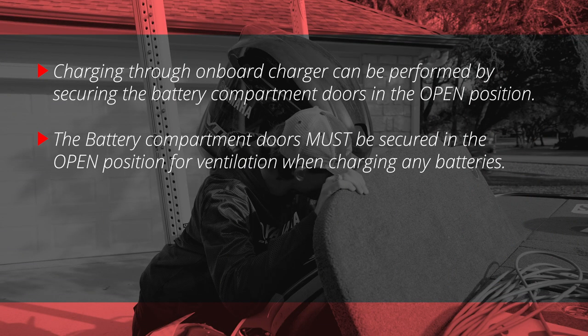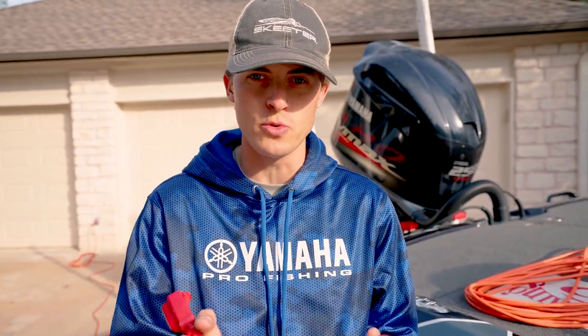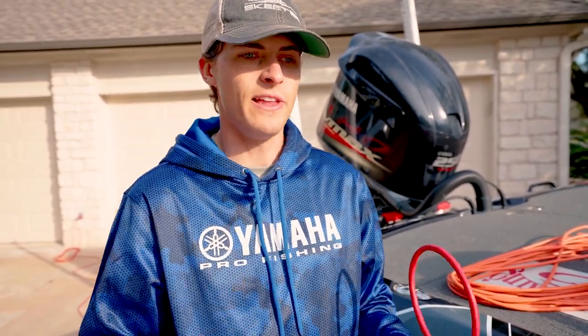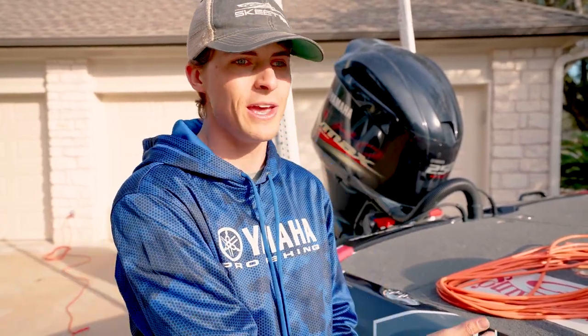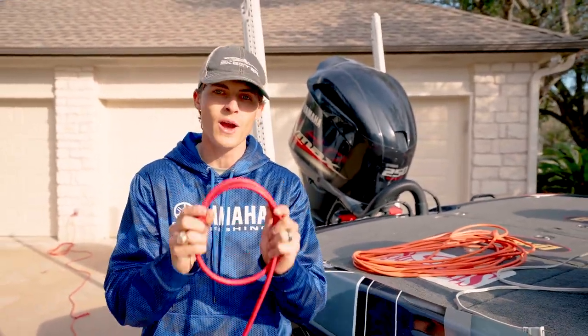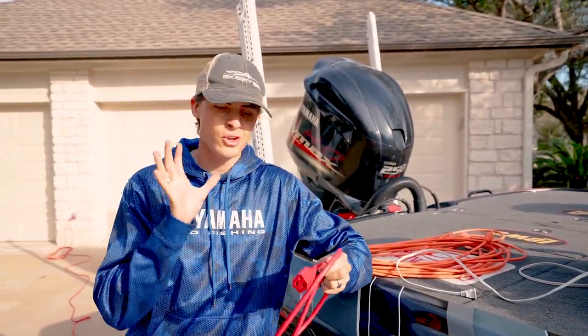The second thing I do is come to the back of the boat and make sure my onboard battery charger's light is on — if the light is on, the batteries are receiving a charge. Now one thing you might not be thinking about when charging your batteries is the actual extension cable you use — the cable matters, and you don't want to use one that's too thin. The thinner the cable, the less power it can transfer from your power source to your battery charger, and thin cables also have a tendency to overheat. If that happens overnight, it can trip your electrical system, breakers, and fuses, and you'll get to the boat in the morning with no charge in your batteries. So invest right now in one or two high quality cables. Thank you all for joining us on another episode — I hope this gave you helpful tips on the intricacies of your Skeeter electrical system. I'm Tyler and we'll see you next time right here on Skeeter School.